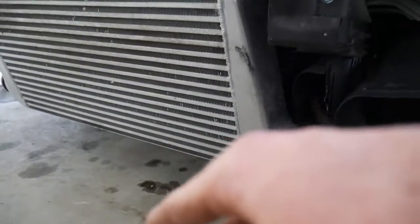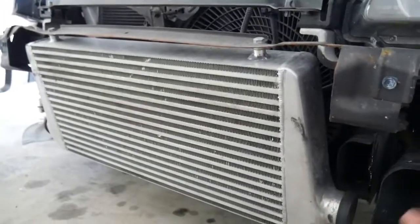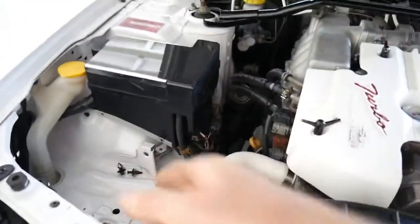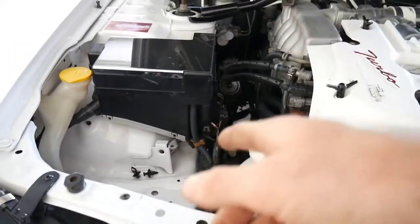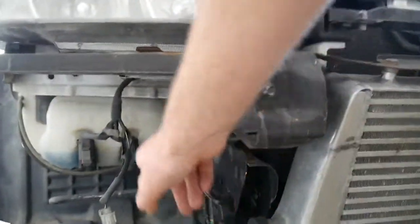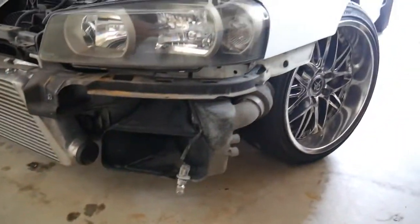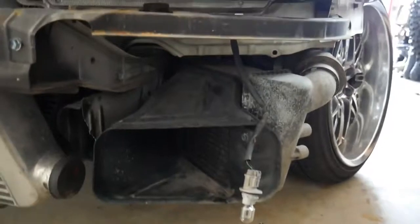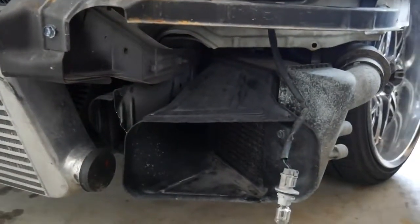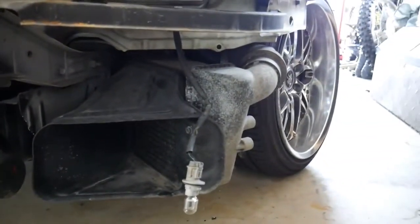One day when I was driving I hit a speed bump and it cracked that bottom pipe. Because it's not a proper return flow cooler, we've got a plenum that needs to go in there — that's why we did the battery relocation. If you haven't seen that video check it out. That's why I haven't bothered piping it back up, because we actually need to get some custom piping made to go up through under where the battery used to be and to a forward-facing plenum. The car is turbo — it's not like I'm posing as a non-turbo car with a fake intercooler.